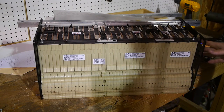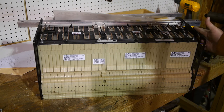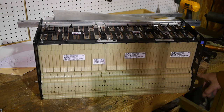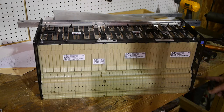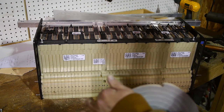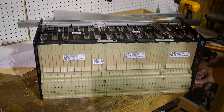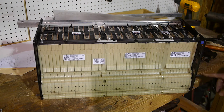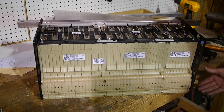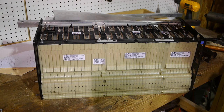The prototype pack is painted with everything finally installed, including the high-strength bolts. One commenter asked about using existing bolts cut down — you can, but using all-thread and making it extra long on both sides is better. When the bolt is removed, the pack expands quite a bit, and it's really a pain to get it all compressed back in. The extra length lets you get things started and tighten it up. The all-thread sticking out also helps protect the ends when installing, giving less chance of breaking them when shoehorning it back into the back of the car.